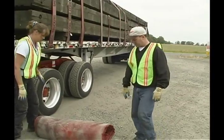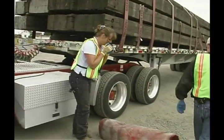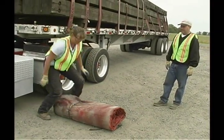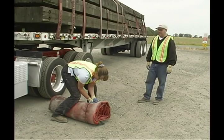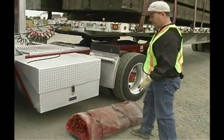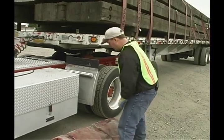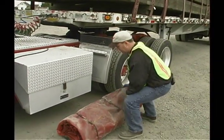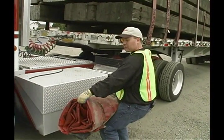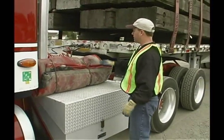It may seem like a pain, but use your safety glasses at this point because anytime you use rubber rope, wear your safety glasses. To get the tarp up to the tarp box, let the ground carry most of the weight, then lift it up. Tarps can be very heavy, especially in winter, so use as much mechanical advantage as you can. Use good proper lifting techniques: lift one end up and rest it on your knee keeping good posture, lift the other end using your legs to support it, and then kick it up to where you want it to go. Once it's up, use a limited amount of energy to position it where you want.